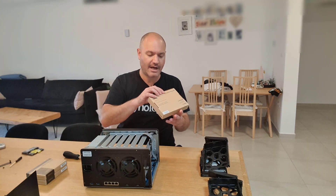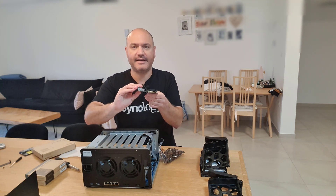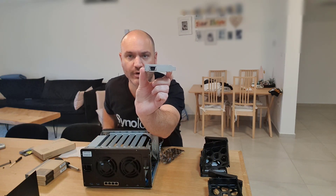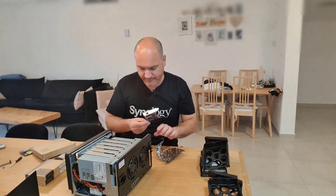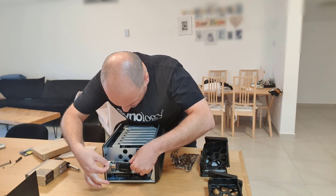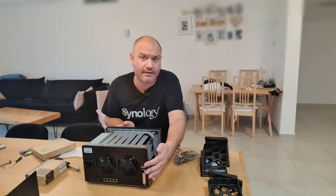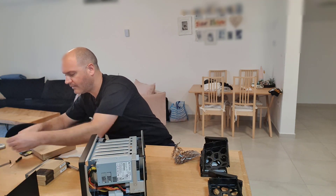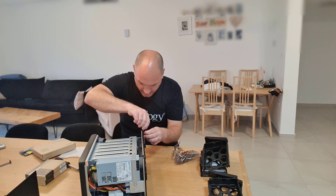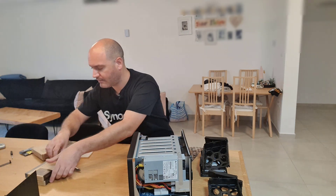As you can see there's a metal casing protecting the PCIe cavity. I'll put that aside. Now it's time to start assembling. Let's take the 10-gig network card out of the box — that's the entire card. A regular RJ45 network cable will connect to it. I'll just take out the card, place it in the PCIe slot, then take the screw we unscrewed from the PCIe shield and screw it back in. That's all there is to it.